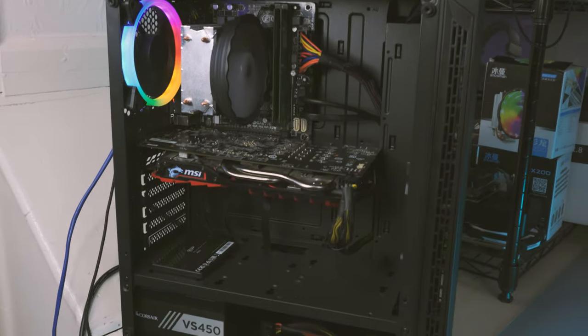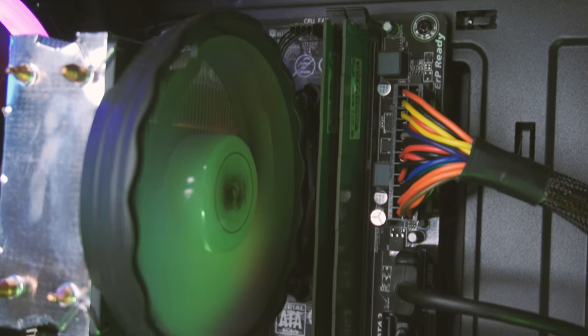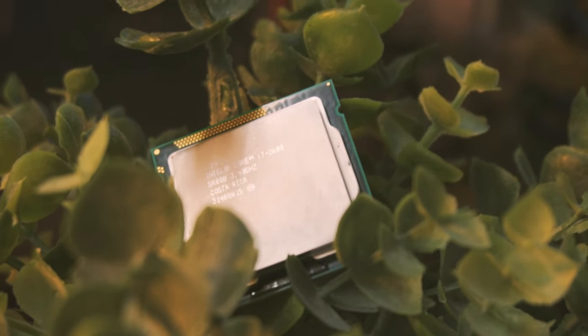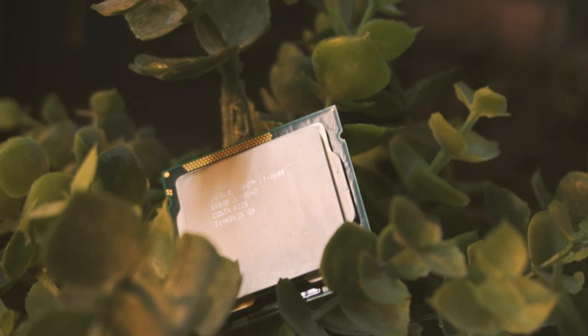So overall, this PC for what it is, is not terrible at all. Is it the best PC I've ever built? Certainly not — there are things I'd like to change: up the SSD to 1TB, the RAM to 16GB, and the CPU to an Intel Core i7, maybe a 4770. But most esports games like Rainbow Six Siege, Rocket League, and Counter-Strike GO won't really utilise more than 4 threads and 8GB of RAM, and that's where a PC like this is very exceptional. I've also finished university for this year so I've got plenty of time to make content — stay subscribed for more!